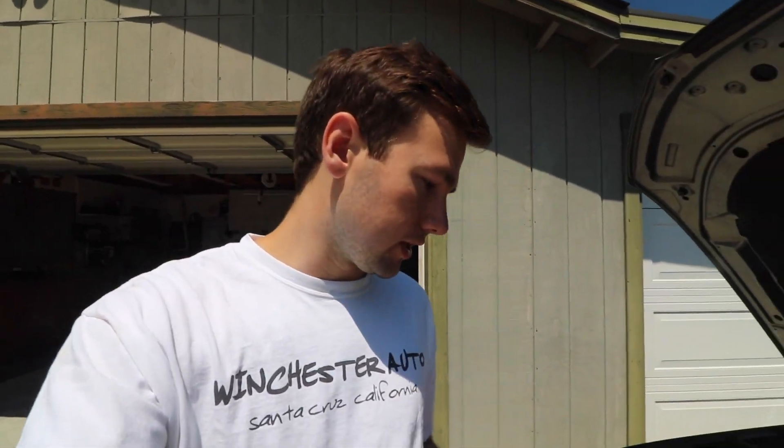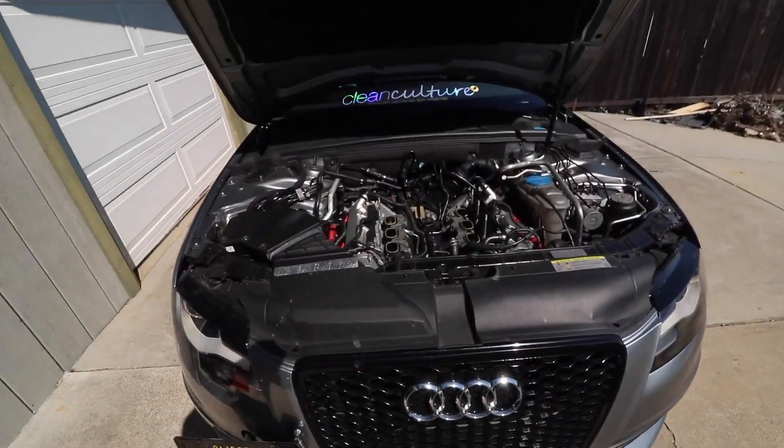This means a lot for the Audi. I think I'm going to first look for a used supercharger like I did last time, but this time I'm going to make sure it's a healthy one — I'll pressure test it again to make sure it holds pressure. I also cleaned out the intake port with a pick and paper towel. I might also look into the option of a ported blower, rebuilt with new intercoolers, because I really don't want to deal with another used one.